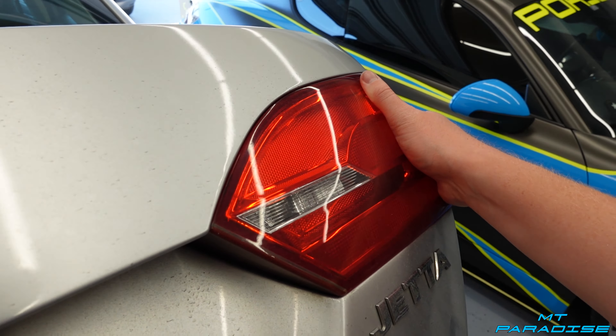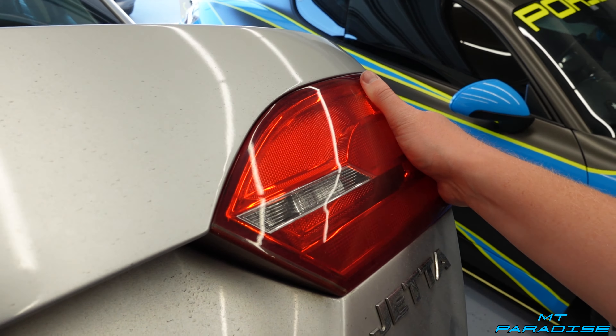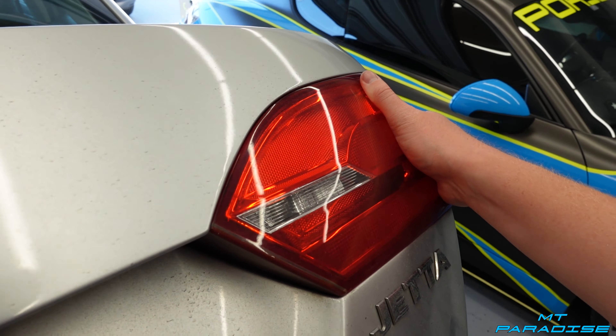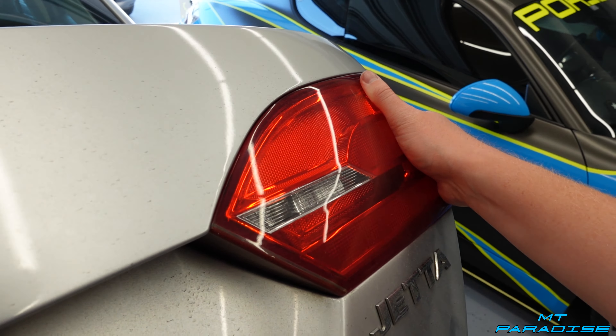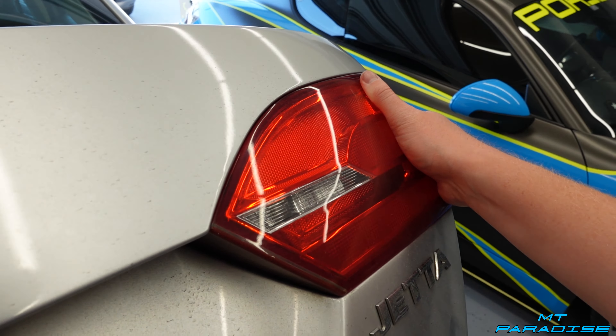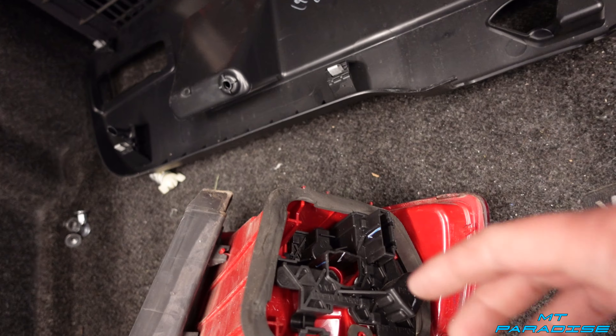Next on each side there's a socket or flathead with a little flat slot in it — whichever you prefer. There are two on that side and two on this side, and then right here there's the plug for the taillight. You're going to pinch the tab on either side and it's going to pop right out. Go to the other side and pop that one out — same exact process, tab on each side, push in, wiggle it, and it pops right out. Once you take off the two screws on either side and have both unplugged, you can grab the taillight itself and wiggle it right out of place.